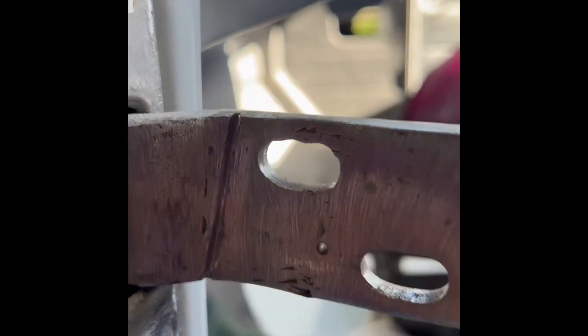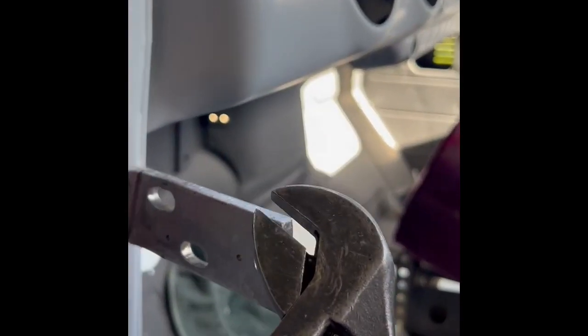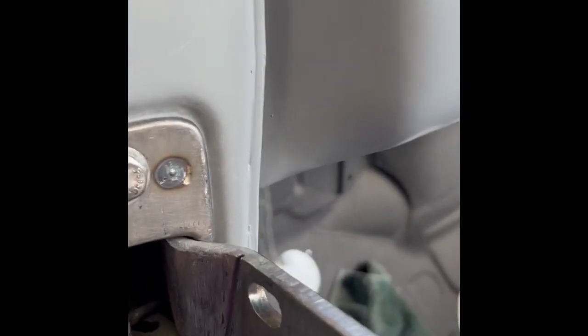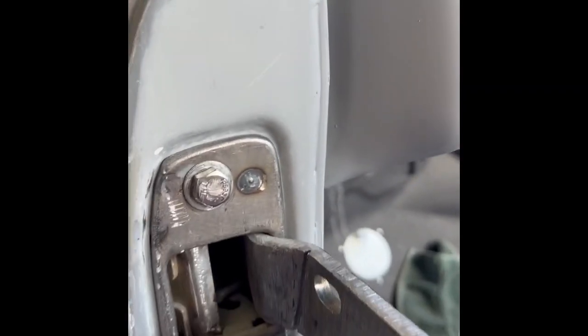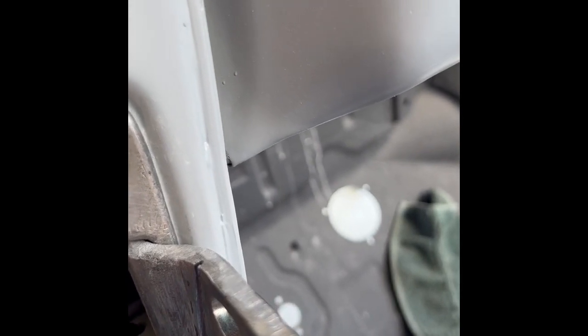What I've done to make this easier is I've cut a little groove right here - maybe halfway, maybe a third of the way through that hinge. I have a big crescent wrench here to move it. To pull the door out, I'm gonna push the crescent wrench towards the passenger door. I only need to move it maybe an eighth of an inch.